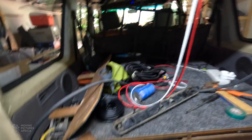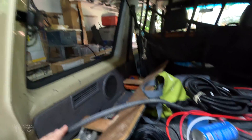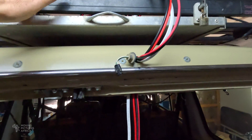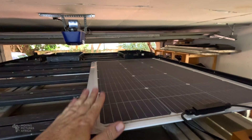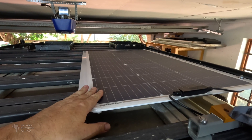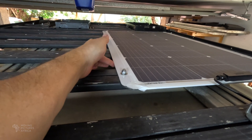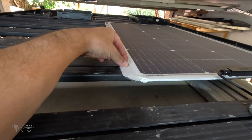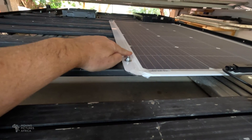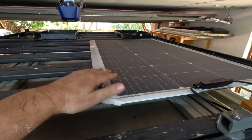So here we are at the back of the vehicle. I'm still in a bit of a mess here — I'm busy pulling cables that are going to run from up here on the roof rack. I've mounted a 100 watt solar panel to offset the power draw the Starlink will have. I've mounted it on an alu panel that I had lying around. I cut that with a knife and bolted it onto the roof rack, then bolted the panel itself onto the alu panel and put a little bit of tape so the wind doesn't get underneath it. I haven't glued it down because I'm always hesitant to do things that are going to be difficult to undo.